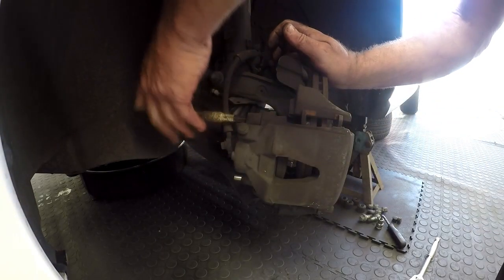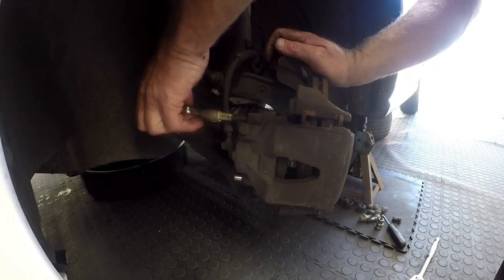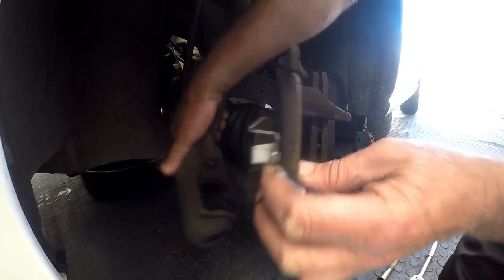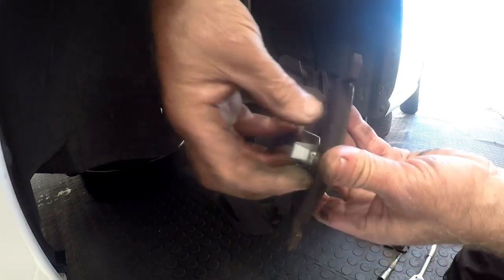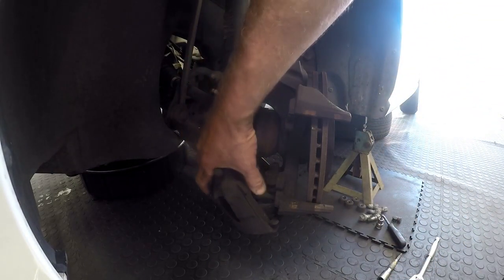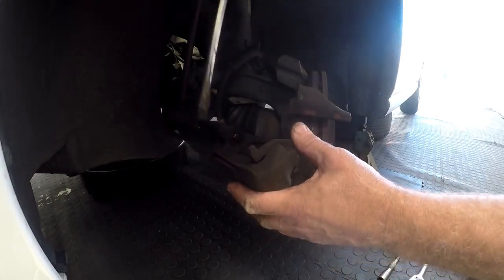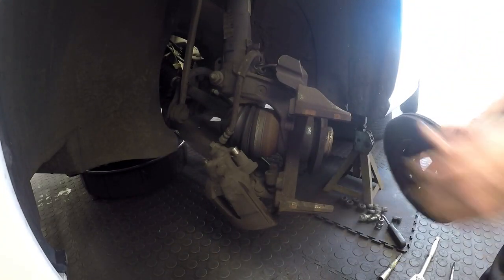Turn the pins out all the way. It's also good to feel those pins — they must slide quite nicely. If they don't slide easily, lubricate them with a little bit of rubber grease. Don't put oil on there because oil will swell the rubber and make it tighter over time. Now take off the floating caliper, which will come off, and you'll find the disc pad clips into the caliper. The other pad gets pushed into the caliper on the other side — pry it loose and let the caliper hang to one side. Take the disc off.